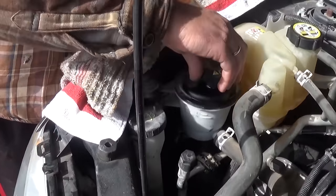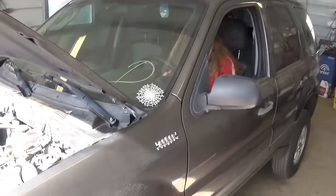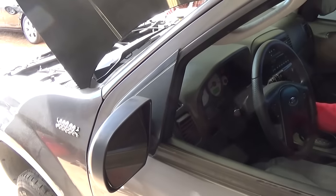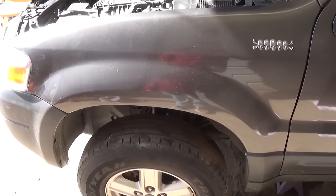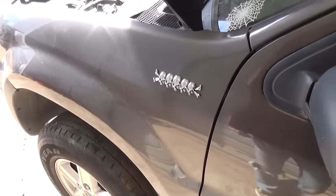Now we need to install the lid on it. We're going to go ahead and start the vehicle and turn the steering wheel again to see if it's going to make the noise like it has air in the power steering. And as you can see, it doesn't make the noise. So go a few more times while the vehicle is all the way in the air.